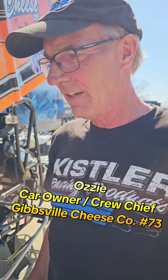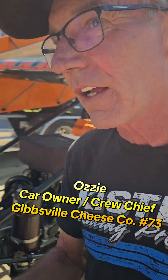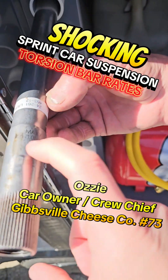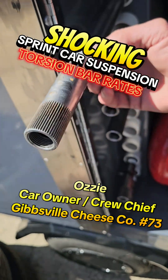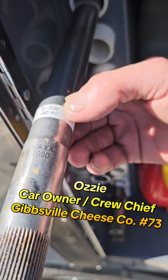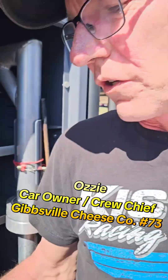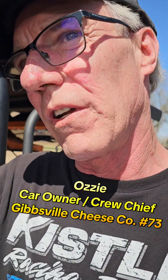There are numbers or rates that describe the stiffness of that torsion bar. For example, here's a thousand bar — on my dyno it reads 463. That number is measured at the three-inch travel point on the dyno. The higher the number, the stiffer it is.